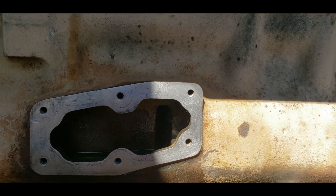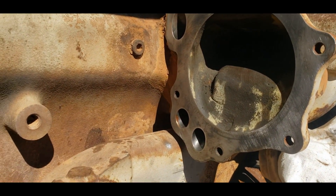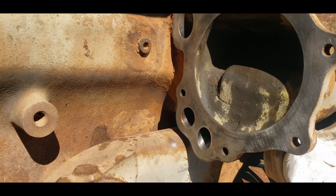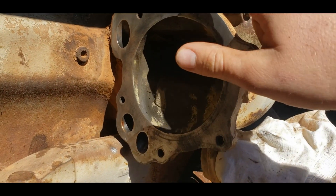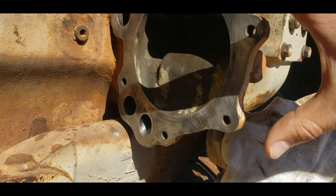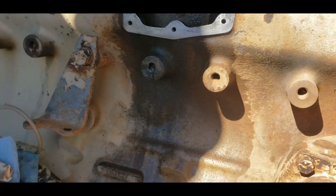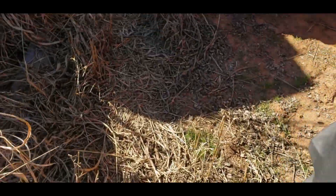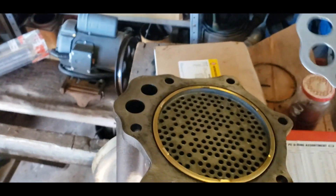All surfaces are cleaned up. Now I want to film this next part so you can see how difficult it's going to be. Basically I'm going to take the oil cooler with the gasket on this end, get a bolt threaded in just enough to hold it and let it rest, then get everything else in position. One thing I want to note: the gasket that's supposed to go on this end came in bent and warped in transit.